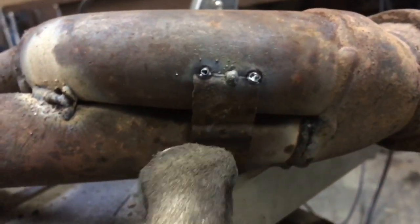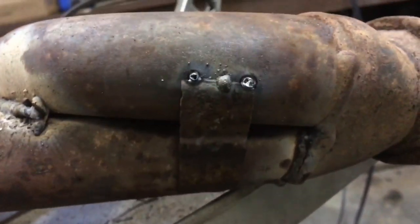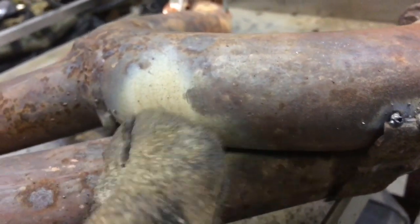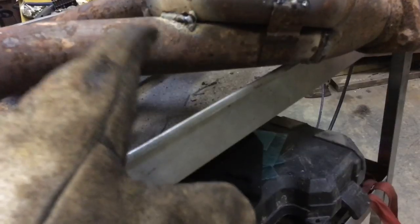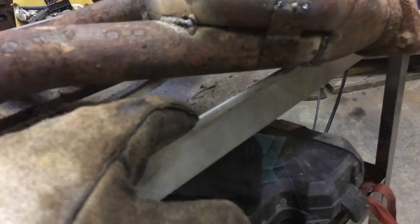So I hope you learned a little something from this. Let's get back to the old header — I didn't have any flat stock laying around so I found this old piece of metal. The flat stock I had was too thick so I tack welded this old piece on. We're going to tack weld the other side and lay a bead here and here. The way I weld it, I weld a T and go between the pipes — this is what I've been doing for the last two years when I couldn't afford a new manifold. I repaired these ones and they ain't cracked anymore.